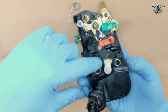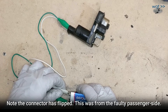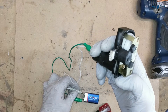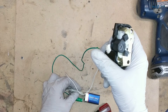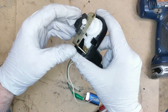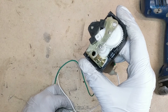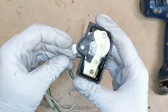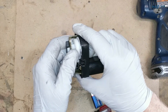Let's try and break apart this motor assembly and see why this works the way it does. After tearing further into this, I was able to extract just the motor drive mechanism. After swinging out, there's nothing to hold it there, and I suspect the amount of resistance it was encountering inside the worn-out latching mechanism was allowing it to swing back. It's not a promising sign that it can fly back that far after it operates. It's almost as though it's not just stopping — and look at that. I played with it and now it's not doing that anymore, so something is bonkers in here. This is worn out, and that seems to have been the root of most of the problems.